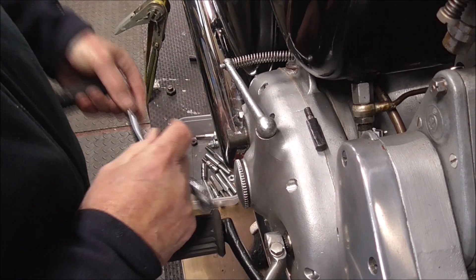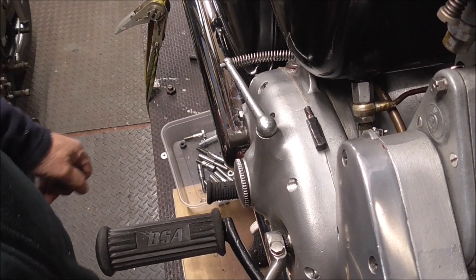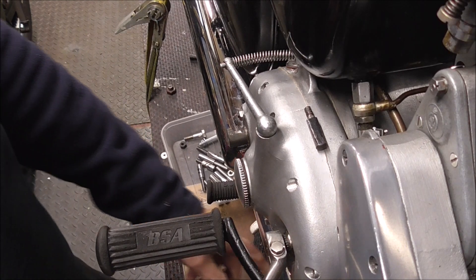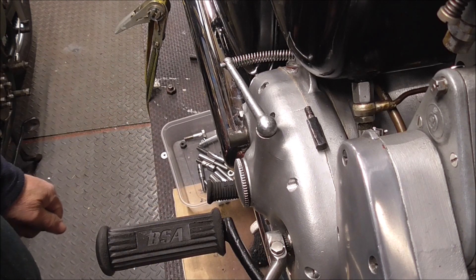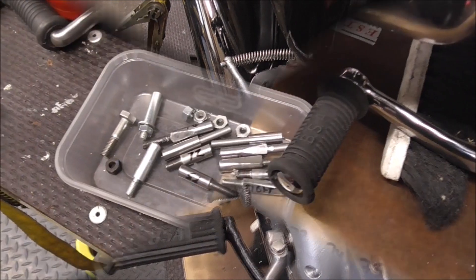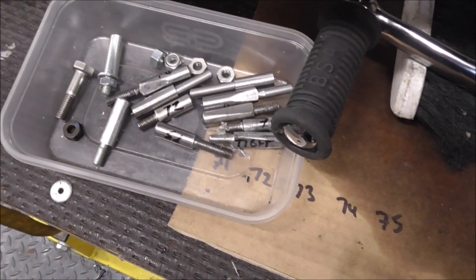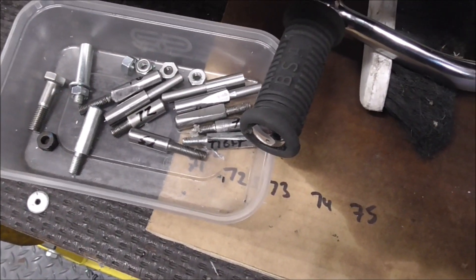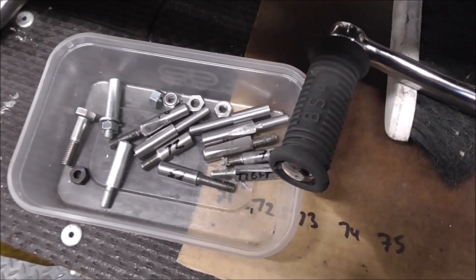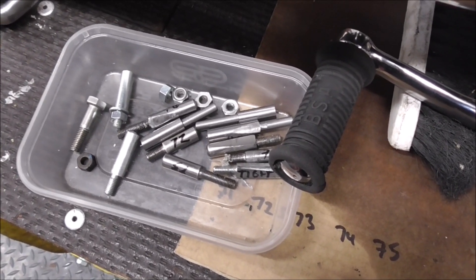So the plan now is for me to make an oversized cotter pin and I'll machine it till it's a perfect fit in the hole on the kickstart and just start from there. I've got a whole bunch of cotter pins and not one of them will tighten up on that new kickstart, so I'll make a new one up oversized and see how it goes.